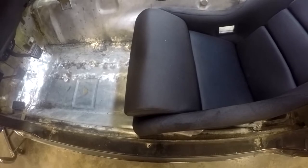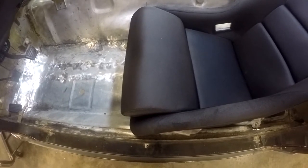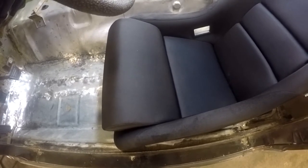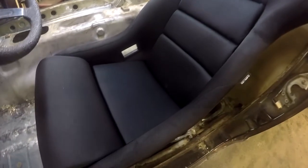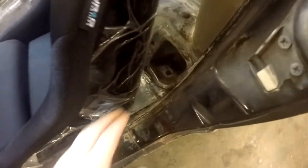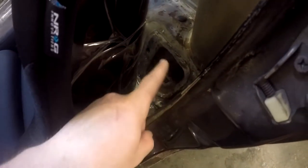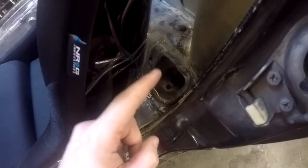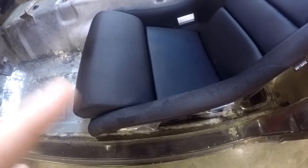I'm definitely not sure what the best way to do this is, so we're just going to try. I need to get it pushed over enough so the seat will sit flat on the ground, because my head is pretty high to the headliner. The further down we can get the seat the better. You can't go back much further because right here is where the mount for the roll cage is going to go — it'll be pretty tight in there. Let's pull the seat out and start modifying the trans tunnel.